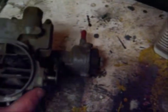And this is set up a little different than the Edelbrock's. And as you see, I have this vacuum line capped. The end of this vacuum line is capped. This, I ran the vacuum advance off of. This on top, I had a breather filter on a special breather that went off of that. Otherwise, I would have plugged that up.